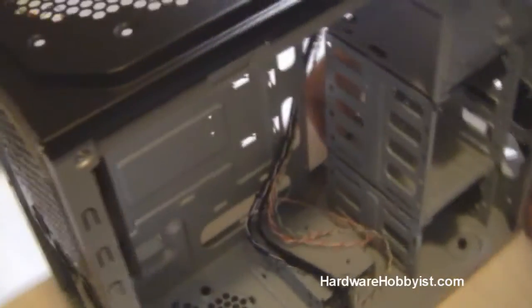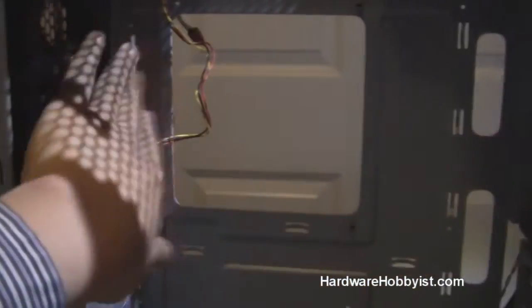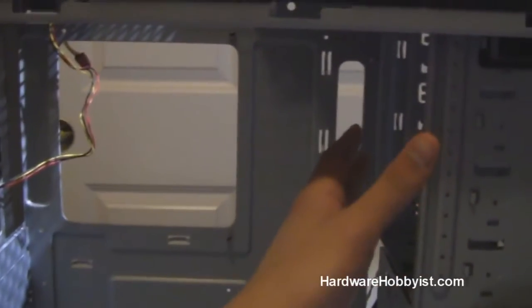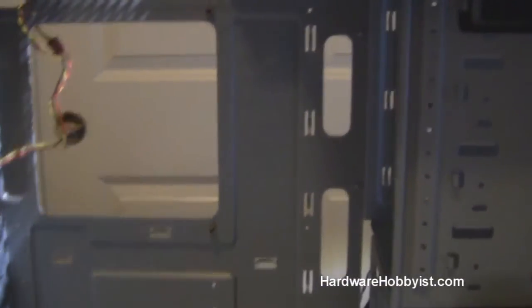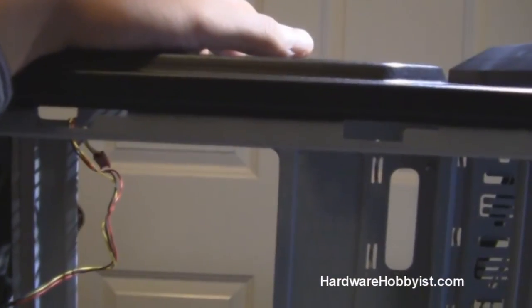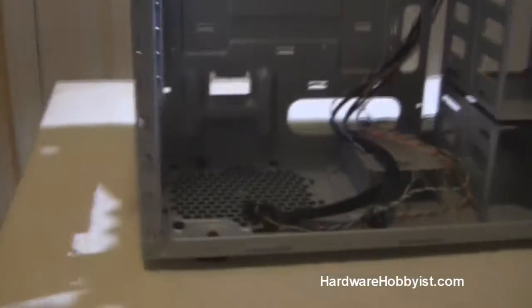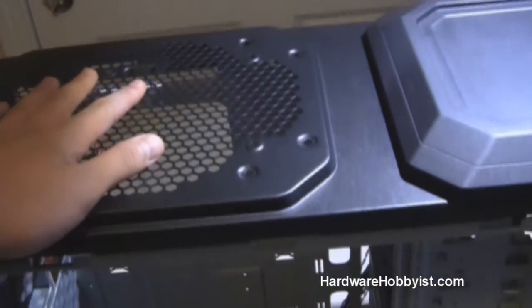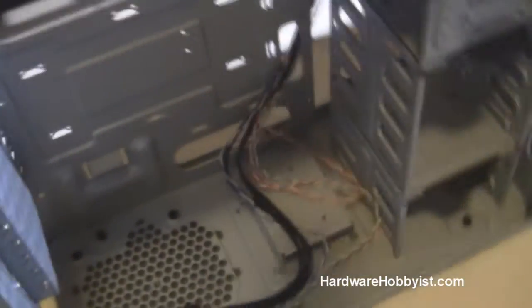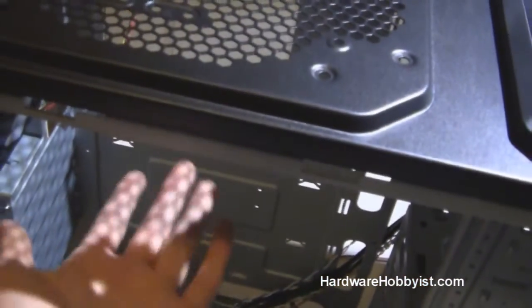While Max is messing with the fan, I want to show you guys the general flow of airflow that you want. The CPU heatsink and fan is going to be exhausting hot air outside of the case, so it's going to be intaking cold air from the front and exhaling it out the back. For the upper region, we're probably going to go with intake of cold air — though this can be reversed through testing. For the front, you definitely want intake so you get cool air that goes through the bottom of your case, and of course hot air rises — it rises out here and is exhausted out the back.